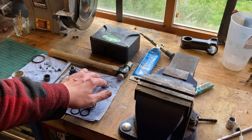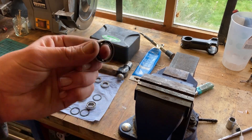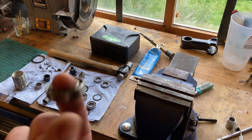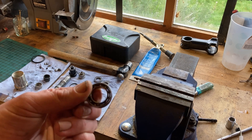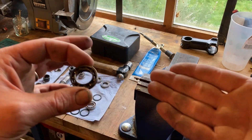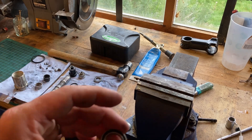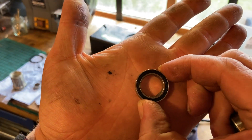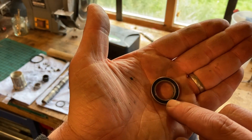I've done a couple of the bearings — I've rebuilt these. Wear on them isn't that bad, and they're Hope ones so they do tend to last quite well. I've cleaned it all out in my ultrasonic cleaner, and I'm just going to put them all back together. This might be a bit of a teaching moment if you're not familiar with what a seal bearing looks like — and these are in most things on bikes now: hubs, bottom brackets, headsets. What you have is this whole unit which has the outer race, the inner race, and the seal — which is the black bit.